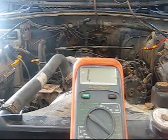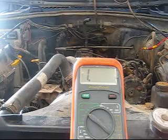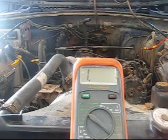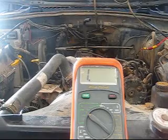And what you'll get from these is a lot of times you'll go out and your Jeep won't crank randomly. It will turn over, but it will not fire up. And what it's doing is losing crank signal, so the PCM doesn't think the engine's turning over. So anyway, let's get started, guys.